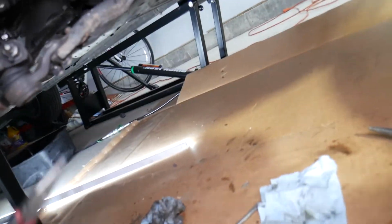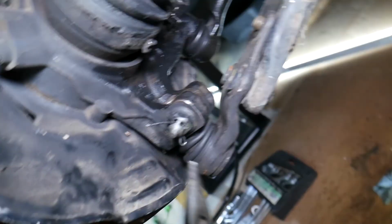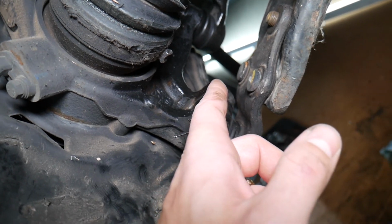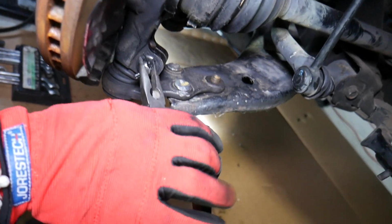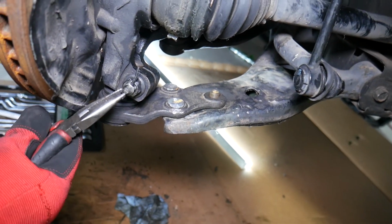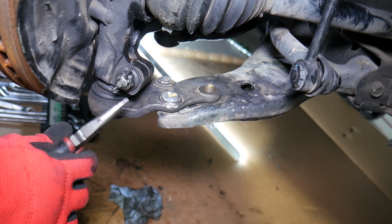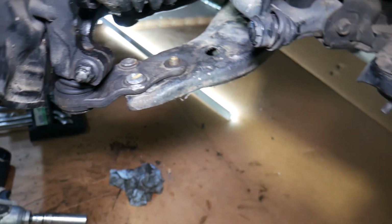What do you need to do now? First, let's explain. Penetrating spray, that's your number one friend. WD-40 is amazing. We'll put the link in the description of the video below. What you will need to do is spray. Most of the designs will be like that on the wheel hub, where you can see there is kind of like a crack, so we can spray from there and let it penetrate. Spray the bolts, nuts, everywhere that you'll be taking things apart. On some vehicles you may have a safety pin that prevents the nut from coming loose on the lower ball joint nut right here, the bolt. So you need to straighten that one and pull it out.